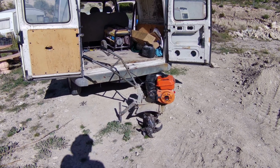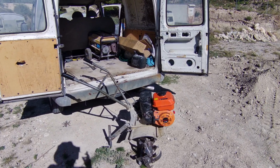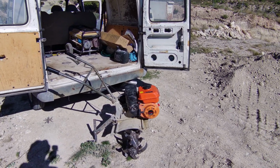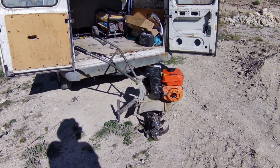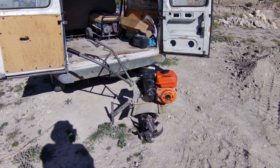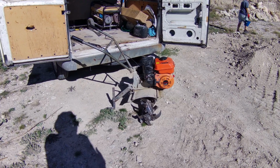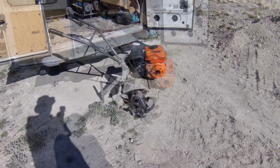Fairly common, I'm afraid. Good advice to anybody is always empty the fuel tanks in petrol engines on these small machines, and then start it and run the carb dry. I know it's not something you'd normally want to encourage in any other circumstances, running the carb or the tank dry, but it does clear out all the old fuel. Otherwise, if you leave fuel in the tank for a couple of months, since now it's no longer leaded, and hasn't been for many years, you get water vapor, and then the petrol goes off and it's no good then. It just bungs everything up.